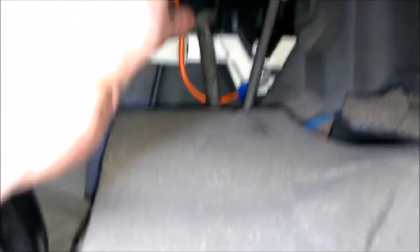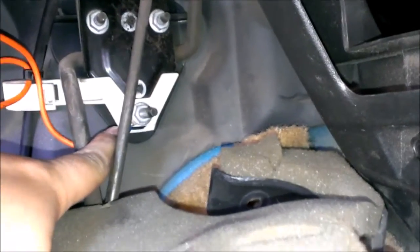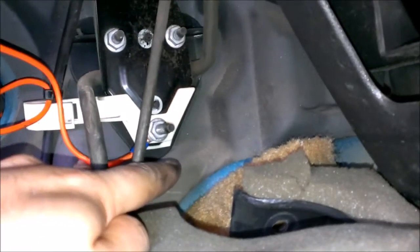On the other side, you want to take your panel down — the wire comes through that piece right there. I just zip tied it up out of the way to make it look nice. For the ground, I tied it into that bolt. Hopefully that'll give me good enough ground — it's going into plastic, but this bolt should be going to body ground. If not, I'll just have to find a different ground down here.